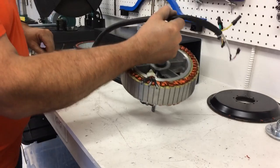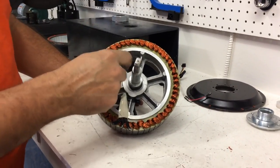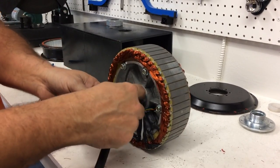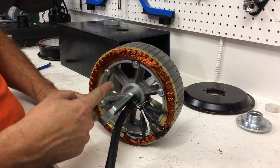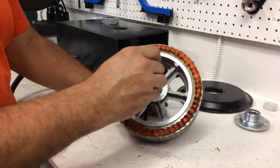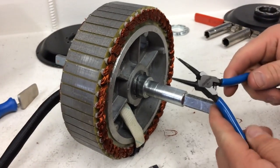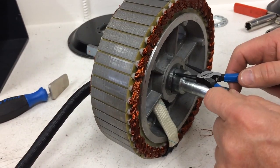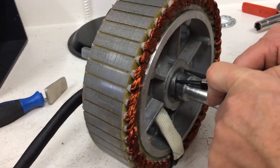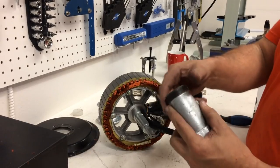The plan is to remove the snap ring and then push the axle out this way. If you try to push the axle the other way, there's a shoulder that stops it. We cheated using two people — while one spread the snap ring with snap ring pliers, I put a regular screwdriver under there and pried it out.